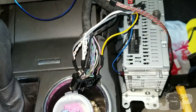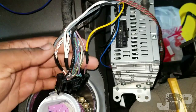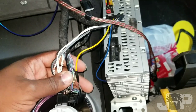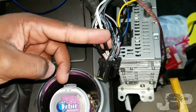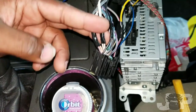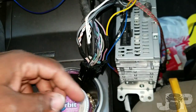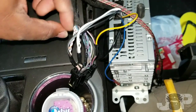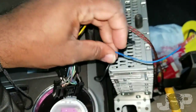If you guys don't know the wire colors, I suggest you get on the forum and look it up — try modified life, 12-volt, or something like that. Either way, all that stuff is hooked up. Now I want to say: I'm only tapping in like this because we're hooking up a sub amp. If I was doing a four-channel amplifier to amplify the factory speakers, I would cut these wires — I showed you guys this method in my other LOC install video. The harness side going to the radio hooks to the LOC for signal, and the speaker side would go straight to the aftermarket amplifier.